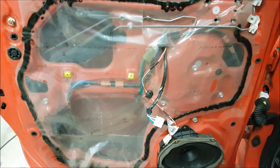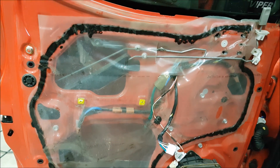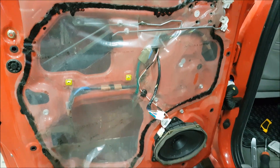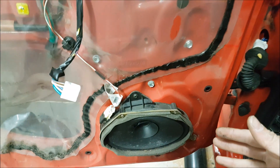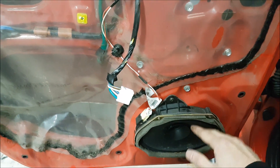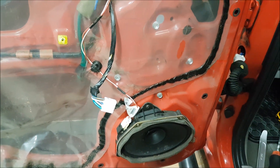This customer had a sound system in their vehicle and they lost the whole left side. We got back the front left driver's side mainly because our head unit went bad, but we're trying to figure out what's going on with the rear left, or the rear driver's speaker. So we took it apart, took a tone generator to it — this speaker does produce sound — we're inspecting it, but we have an open circuit up front by the head unit.